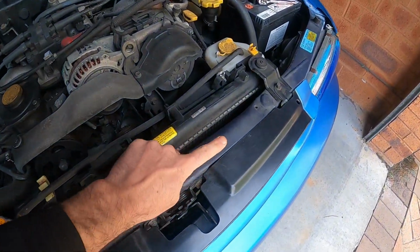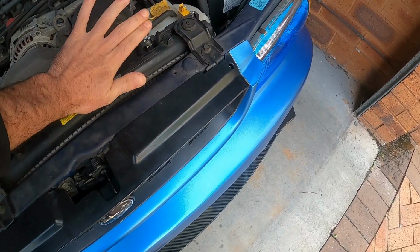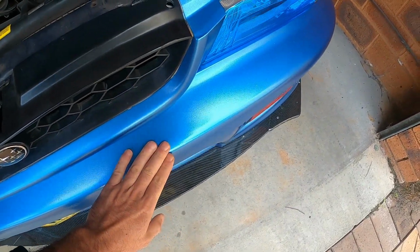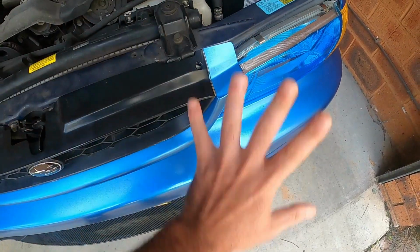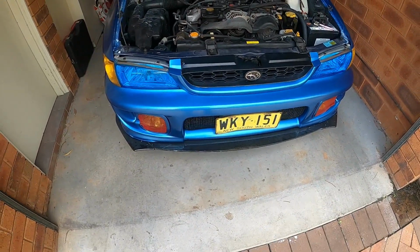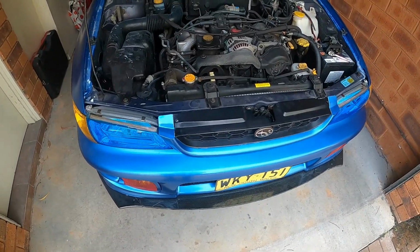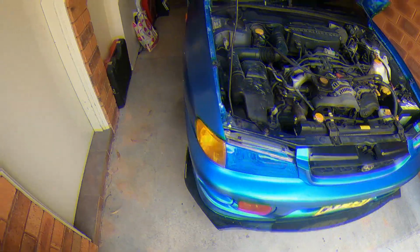There you go. This is the radiator support. It was bent inside, and because it was bent inside, the grill wouldn't line up properly. And even when you put the bumper in, you can still see massive space over here. So it wasn't lined up good. Now everything is perfect in the right spot. Cool, quick, easy fix. Didn't cost us more than $19, which is the straps. That's it. Let's get the car out and start working on something.